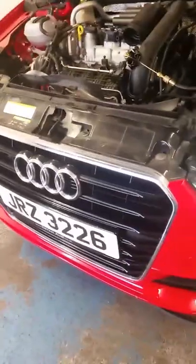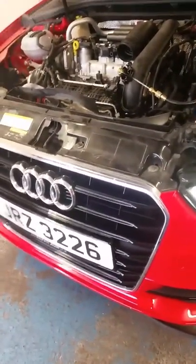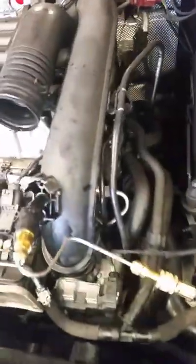However, the problem with that is the fuel doesn't wash the back of the valve, which keeps them clean in a normal type engine. You can get a lot of build up in the back of the valves from that PCV. Also in around the throttle plate and in that manifold itself.